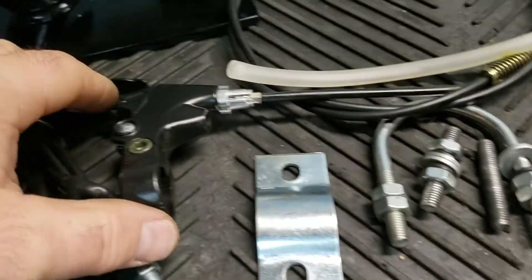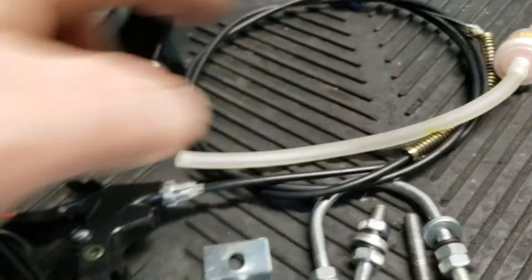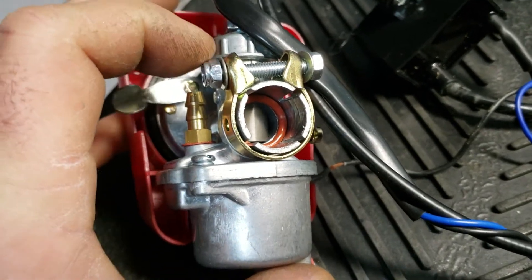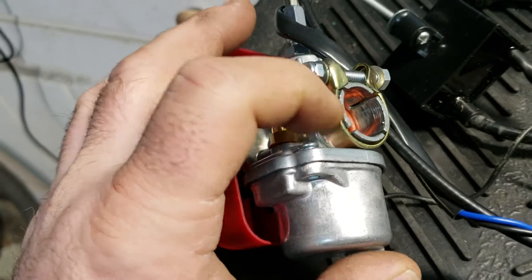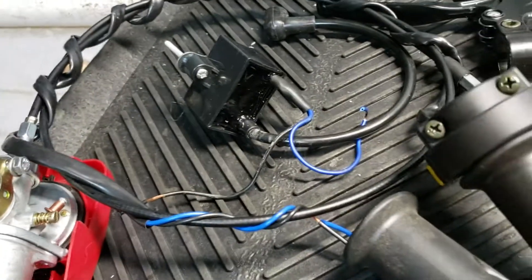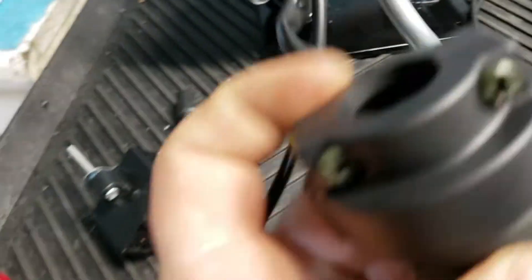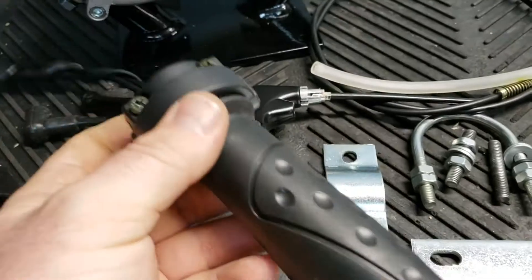The clutch cable is all put together and ready to be put on the bike. I put oil inside the cable so it operates real smoothly. On the carburetor, an O-ring is added. This bolt is also added because the factory one is just garbage and strips out right away. I go through the whole carburetor, make sure everything's tight, take the bowl off, make sure the jet's tight — pretty much go through the whole carburetor so it's ready to use. The throttle assembly and carburetor are all put together and ready to be put on your bike. The throttle cable is well lubricated, and I put grease on the inside of the throttle tube too.